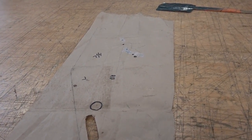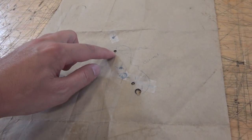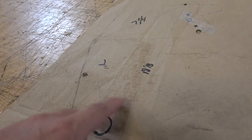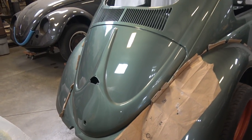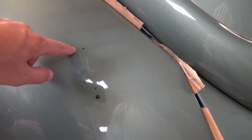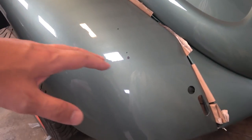I'll have a link to this picture in the description below so you guys can download and use it for your Beetle. I did mess up a couple times like always — the first stab at it you might mess up — but this is basically the way the hole mountings are on a honeycomb tail light. Here's a project Beetle: a '56 oval ragtop we're working on for a client. We had the fenders painted but no holes drilled — I told them not to drill the holes because I wanted to do that. You can see I did mark up where the tail light placement would go, and the diagram also gives you the size of the drill bits to use.